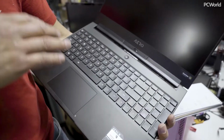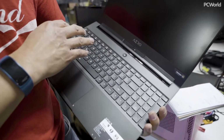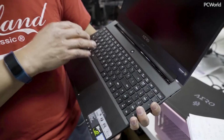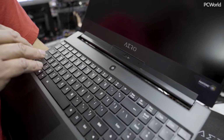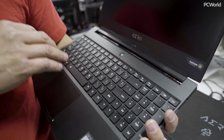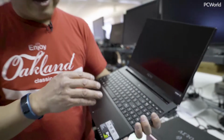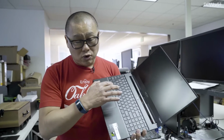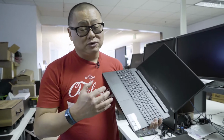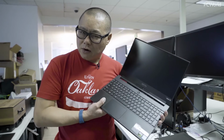It basically has inside of it a 6-core Core i7 8750H. That's base clock 2.2, which obviously is worst case scenario, and up to 4.1 gigahertz. I'm going to guess it's really going to be buzzing along in the mid 3s all the time. The CPU, of course, is a big deal. 6 cores, unlocked, which I did not realize is actually an unlocked processor in here. Nice. Probably not going to overclock on this platform.